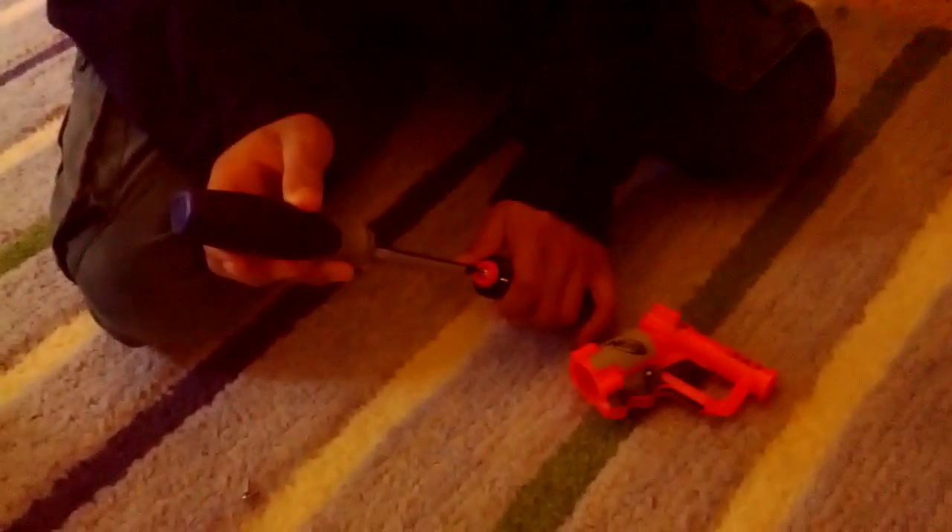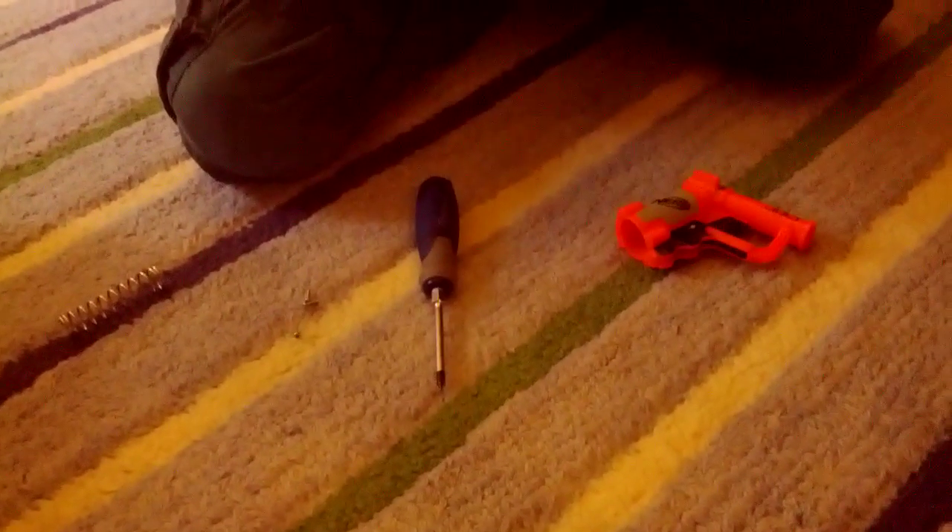The Jolt is a pretty powerful gun. To make it even more to your likeness, there will be a screw on the top of the air compressor inside an orange ring, and you will need to unscrew that, taking the whole thing off and leaving it to the side. Then you will take off the spring and put it to the side, and then put back the air compressor. There's a little hole on the cocking device, and you will put that in and screw it down until it's tight and not wobbly, so your air compressor will be able to shoot the Nerf gun and shoot the bullet far because it compresses the air in the air compression chamber.